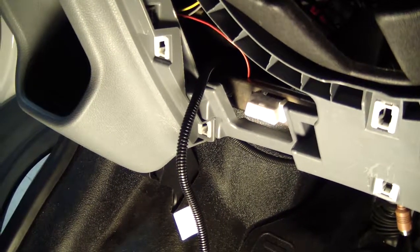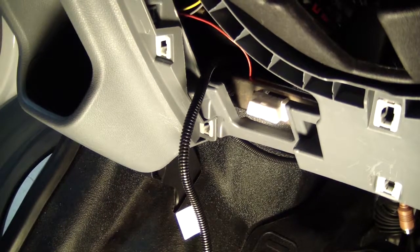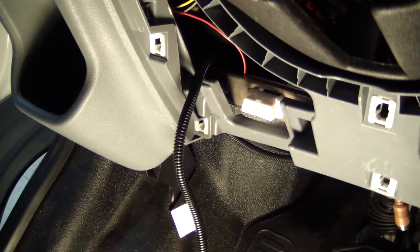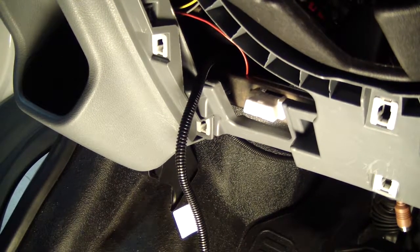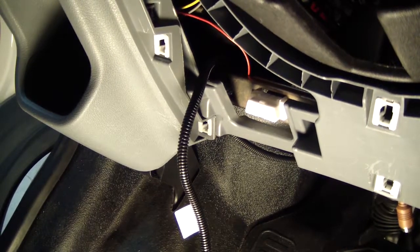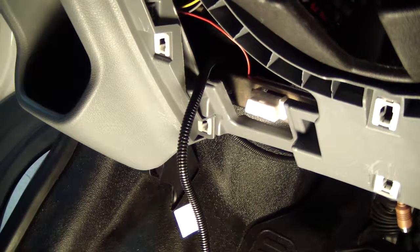You can plug your scan tools onto this and do diagnostic troubleshooting through our T-harness — we're going to pass all vehicle information through that. If you're doing any reprogramming to modules on the vehicle, we do recommend that you disconnect our red connector from the factory OBD2 connector, program at that point, then reconnect us, put a wire tie back on, and put us back into place.